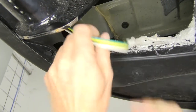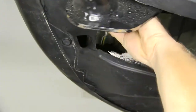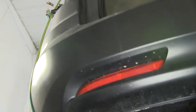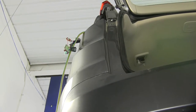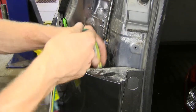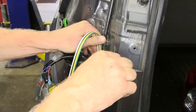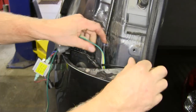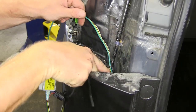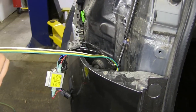With the hole from the hitch, our wire is pulled through and pushed back up. I used a simple wire pull — an old piece of airline tubing works, but any wire that holds its shape will do. Once the wire is pulled up, take up all the slack you can and anchor it to the factory wire harness with a zip tie. The zip tie side goes to the passenger side, and the other side goes toward the front of the vehicle.